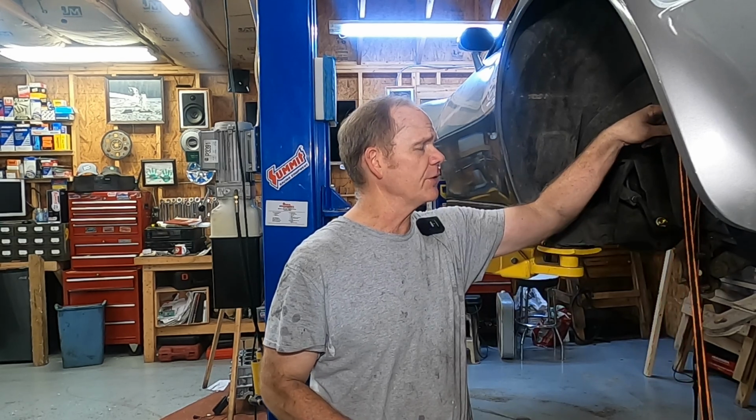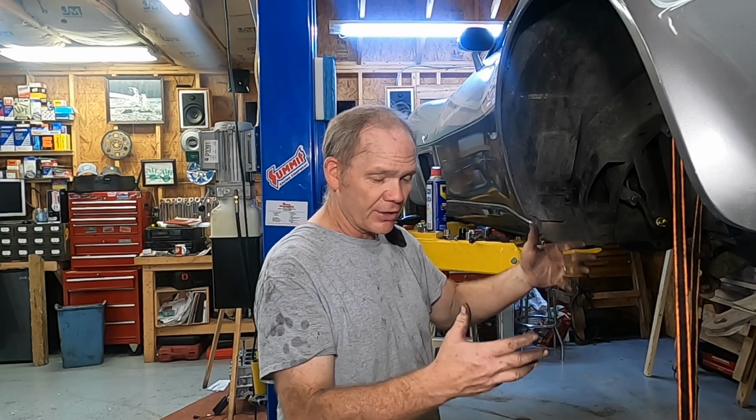So I wanted to do this by the book. And that's what we did. All the steps that you saw here were 95% by the factory service manual in '78. But we got it out of there. It's pretty heavy, so I'd recommend putting some straps up here. I put some straps up over the bump stop bracket. You can take the bolt out and then lower it down really easily, and that worked out really well.